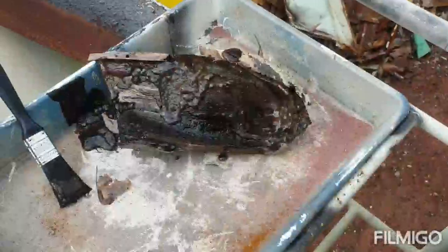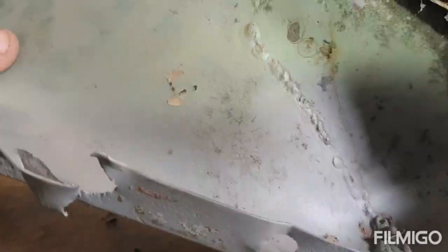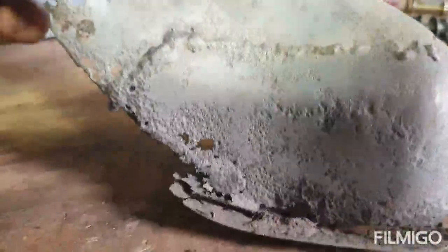So there's the yuck. After dipping this in some paint stripper and then sandblasting, you can see that this guy really, really, really enjoyed overlapping stuff. I think I'm going to grind down this weld, cut it along there, trim off — as I cut it, that piece, which is the old overlap piece, will fall off. Re-weld it so it's smooth, no joins, nothing overlapped, and then I'll rebuild it.